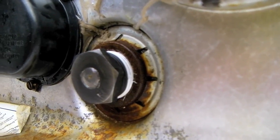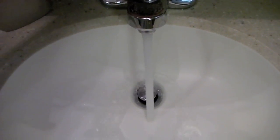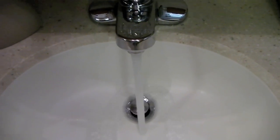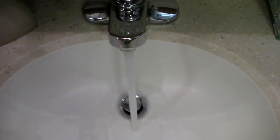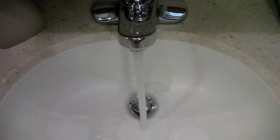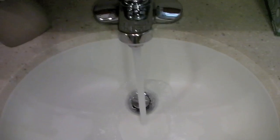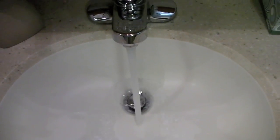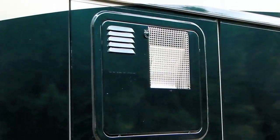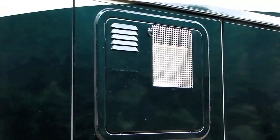Now come into the RV and turn on warm water. It's normal for the water to sputter and foam in the beginning, but keep running it until it runs completely clear. The reason we run warm water is that some vinegar can also get into the cold water line. Make sure to run every single faucet in the house until all vinegar smell is gone and there's no more sign of foaming. Reinstall the cover, turn the hot water back on, and you're all set for another year.